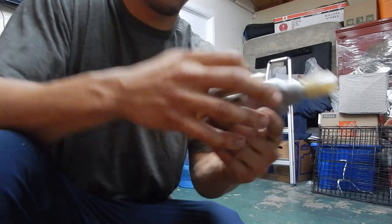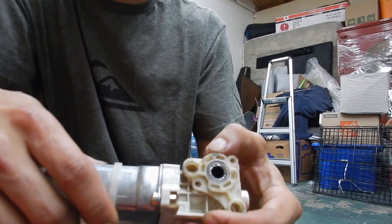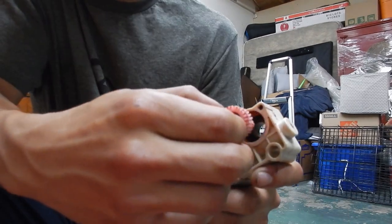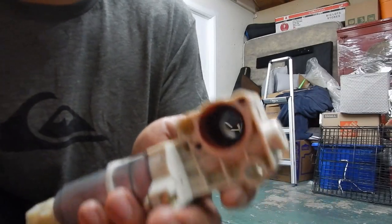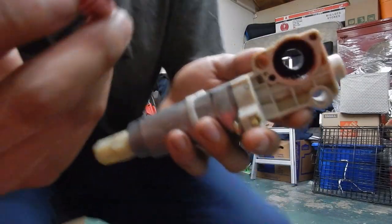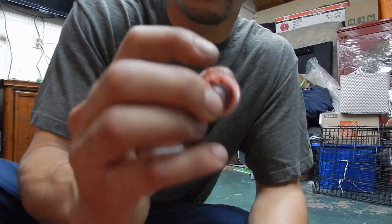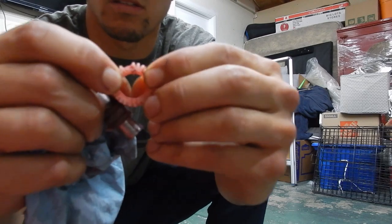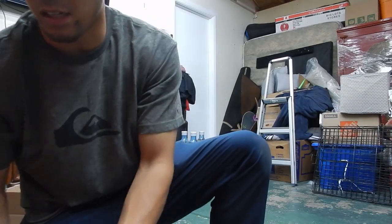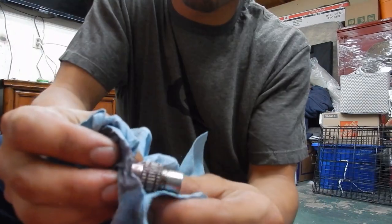The motor is out. Next step is to take out two Phillips head screws, then remove the cover to reveal the metal gear at the very bottom. The metal gear moves against the plastic worm gear, and the teeth either get chewed off or the whole thing splits. There's plastic debris stuck in the gear - you can see the crack. When they crack, they stop rotating on the knurls.